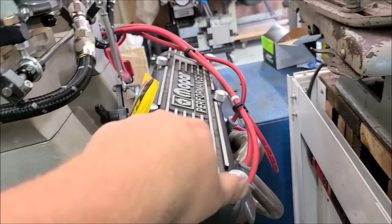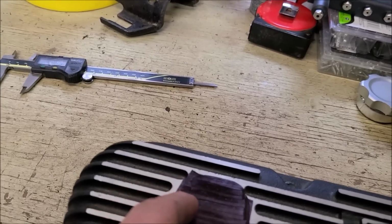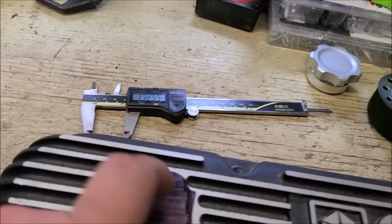So on mine, I've got to put the holes in them, and these tops are really thick. Well, we can't find my blue Dykem fluid. It should be over with the lathe, but we can't find it anywhere. So Sharpie it is. In the middle, we're going to mark it with a T with our calipers here. And then that'll tell us the dead center where to put a hole.